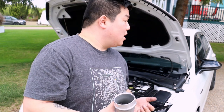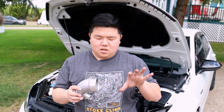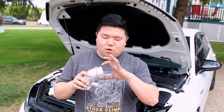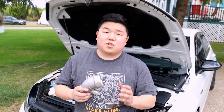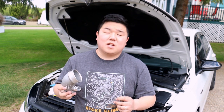For myself, I have the MST Performance intake hose that goes in here. It's made out of silicone, so it goes in here, and in my opinion it works really good. It's not like brands such as CTS Turbo or other brands where this part is narrower than this one, so your factory hose will fit. But if you do have the Integrated Engineering one, make sure you have another aftermarket intake hose that will fit to this, because the factory one will not fit.